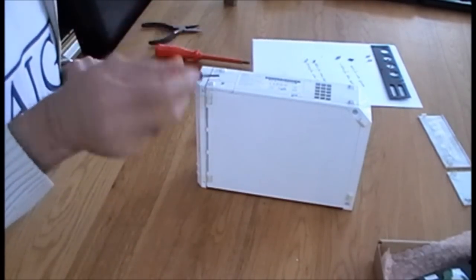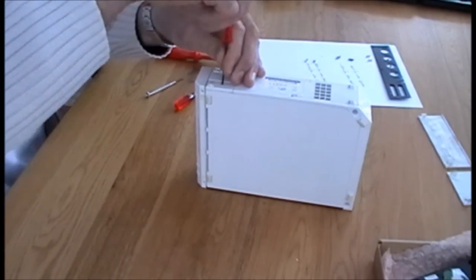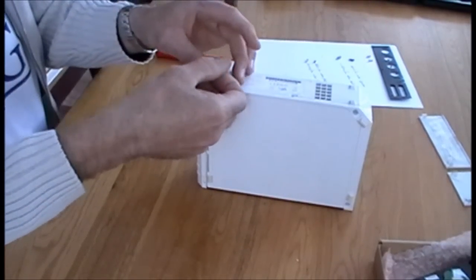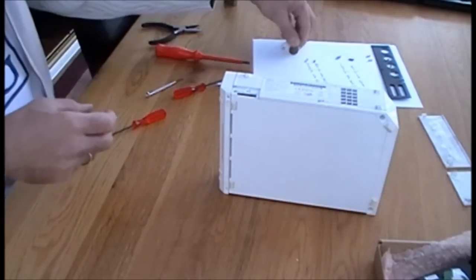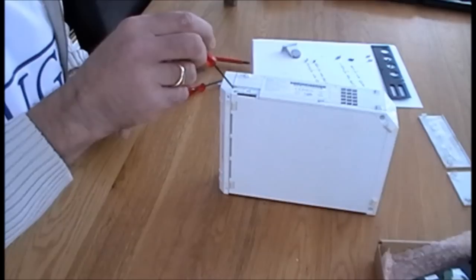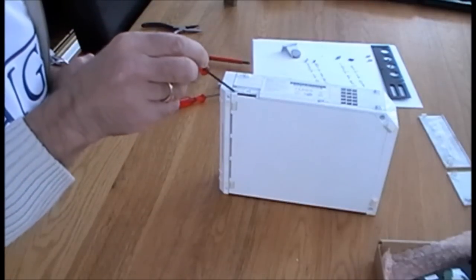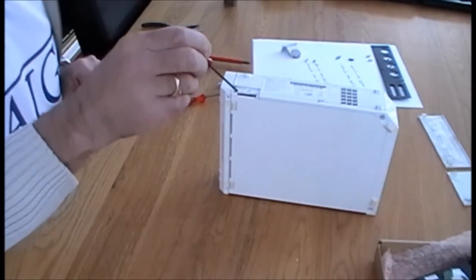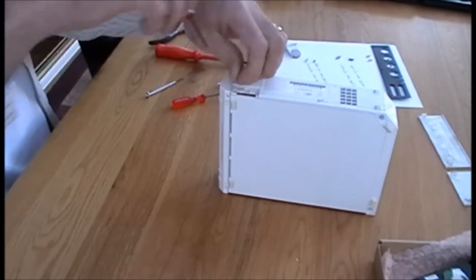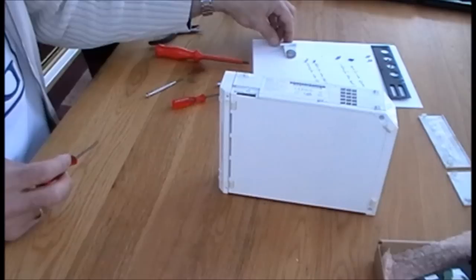Then we've got the battery compartment, which is a silver Phillips screw. We're going to remove that. Okay, this then I'll just lift out and we'll place in there. Okie doke. Next, you'll see we've got a tri-wing screw, silver, which is here. Silver tri-wing. We'll remove that from underneath the battery cover, like so. Place it alongside the battery. Okie doke. So we know where that's going.